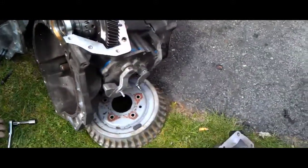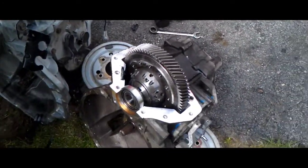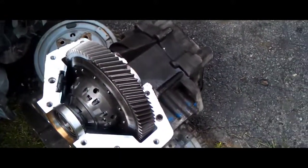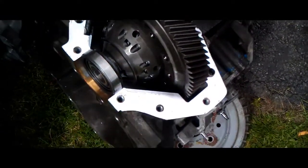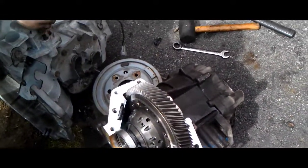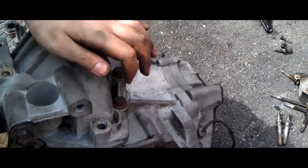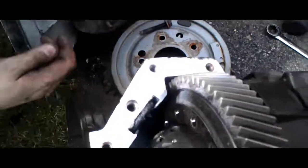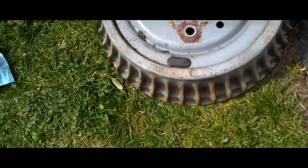I'll take it from here. Real easy guys — of course it's going to be a lot better if you have the transmission out of the car. But essentially all your LSD is, is a big planetary gear that you see here, which is attached to the input shaft and of course the transmission. To get this off isn't really too much hassle. All you need is a rubber mallet, some 15mm sockets and an 18mm socket to get this apart. Once you get all the bolts loosened out, essentially all you're going to have to do is take a rubber mallet and start pounding these up until the casing comes off like this.